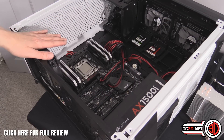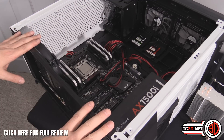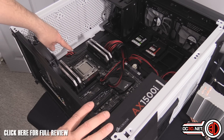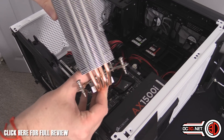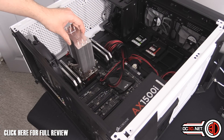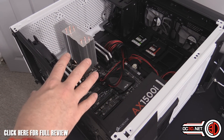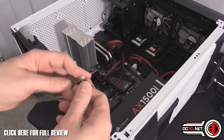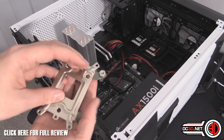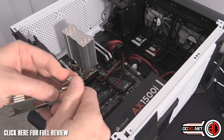We're still testing on a 2011-based system so that all our graphs still match up — we might be changing our kit shortly. To install, you simply add the shorter standoffs into the backplate that's standardly fitted on 2011 boards, then get your cooler with the hold-down, position it, apply thermal paste, and screw it down. If you're putting this on a 1155, 1151, or 1150 motherboard, you use a backplate with standoffs through the motherboard holes, with the backplate on the other side of the board, and tighten the screws.